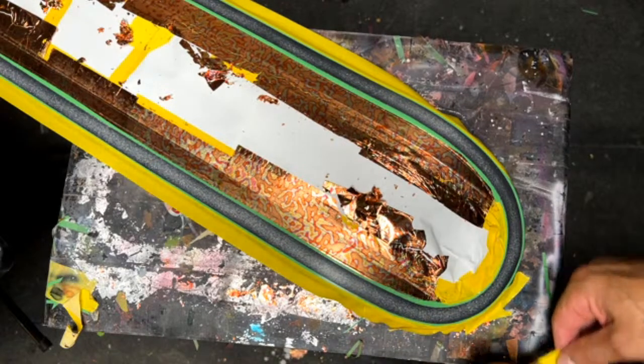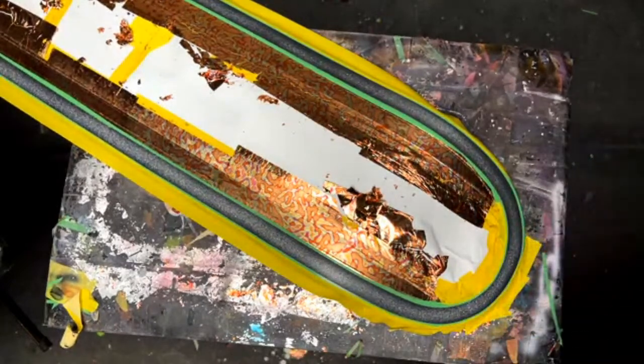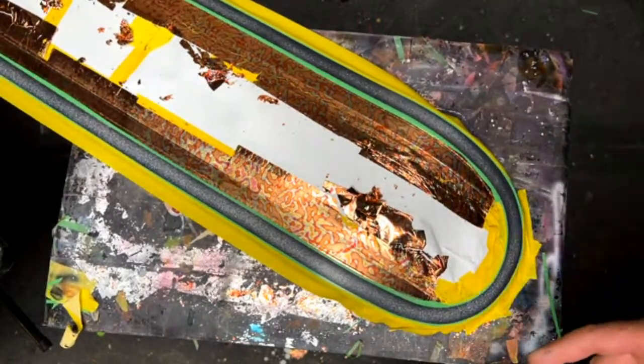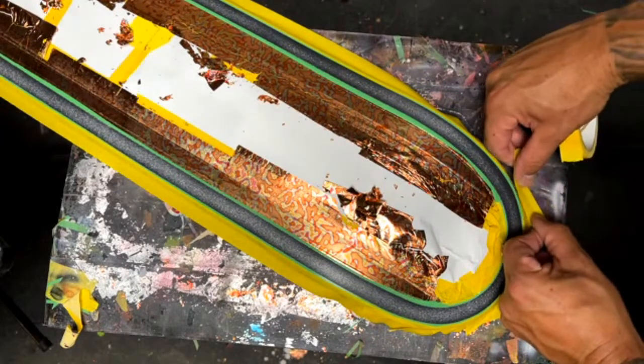So they teach you on and off the trigger, like full blast. That's kind of how I learned, and that's how you make a lot of mistakes too. So if you're not in a hurry, where you're painting a whole car, and you just take it nice and easy, you can always just feather it. Build it up slowly.